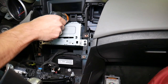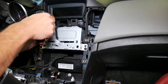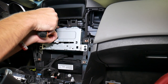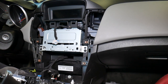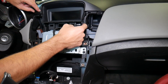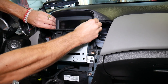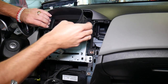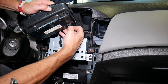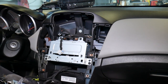We still have more to do to get the radio out — it's all an easy task. We have two more screws to remove on top; this is for the infotainment screen. Now right here you're going to have a few clips — two big ones and three little ones. I usually grab it, pull it out, remove it by pressing down and disconnecting it. You can see it's out.